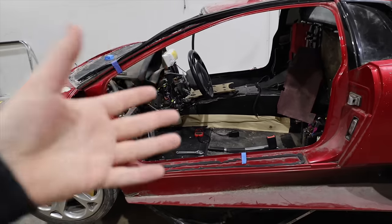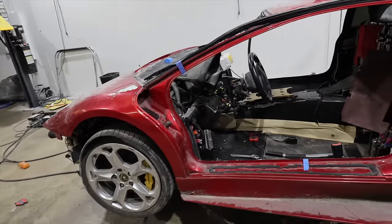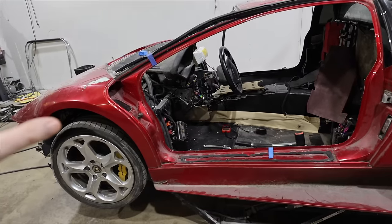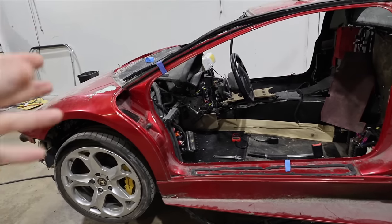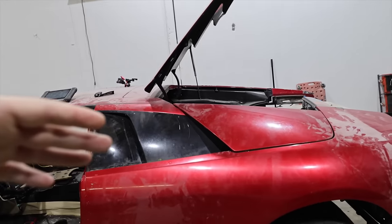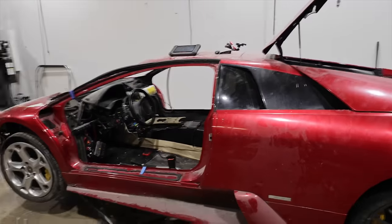So the way that we tend to do it with that stuff, after a car's been salvaged and you don't really know the state of anything, is if you clear the codes and they just aren't coming back, don't worry about it until maybe they come back. If they come back, then we're gonna start hunting into things, which is most likely gonna be a throttle body issue. But no point in wasting time if you don't know if you have an issue.